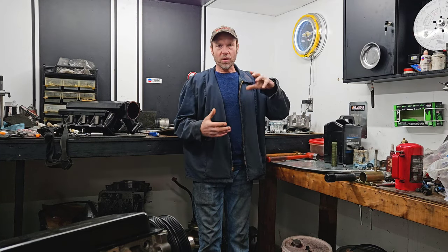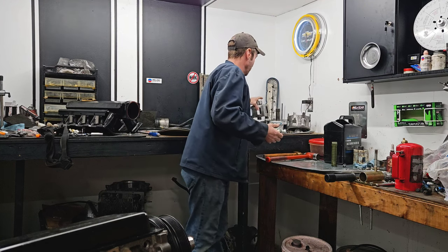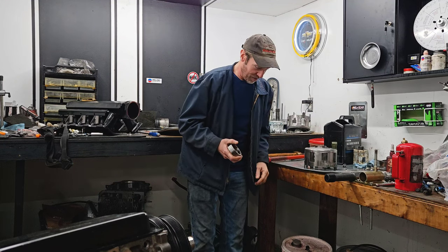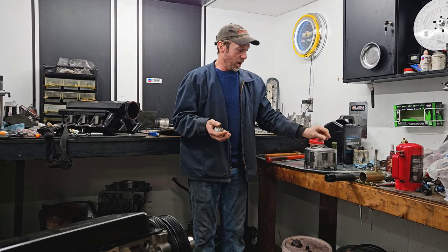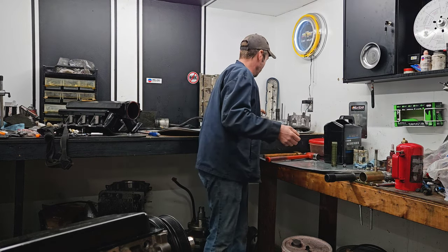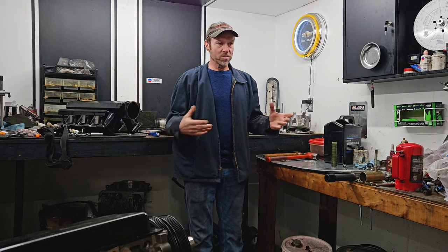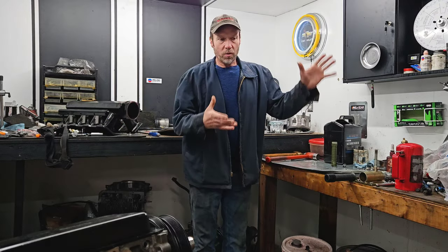So I start pulling the components out of it, and I'm looking at this component right here. You've got a Sonnax Smart Shell, which is top of the line, and even this bearing is just shot. It's got crud all in it. There's no way you'll get that cleaned up. I couldn't get a bearing in time, so I got another Sun Shell, and I start looking at those types of components, and I go, what is the point? There's no point in cleaning this all up. I still have the possibility of having metal in this thing. Throw it out. Let's start over.